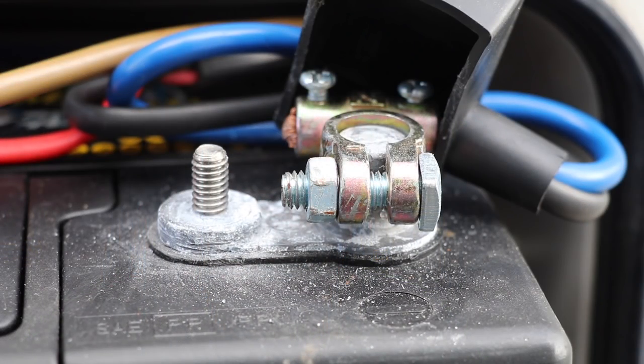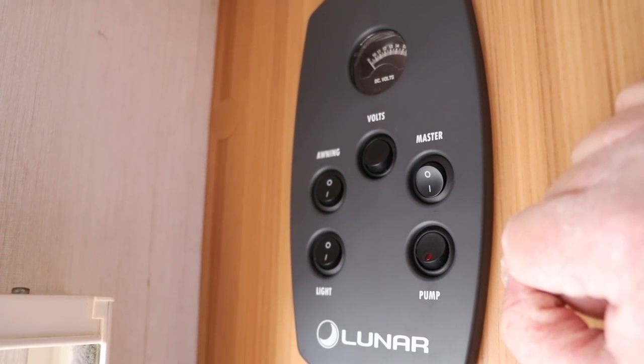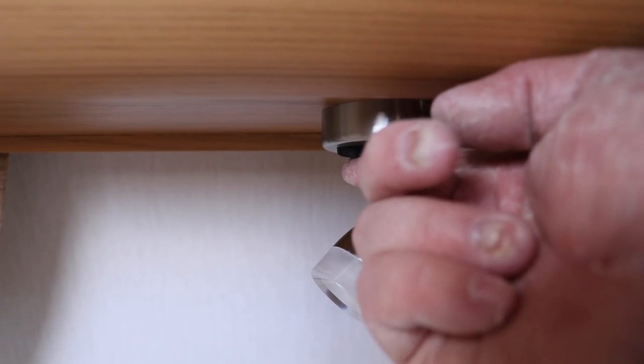Once we're happy with the battery, reconnect it back up to the caravan. Ours is permanently connected because of the solar panel, but it's a good idea to check the contacts — make sure they're not corroded and not fouled up. Give them a good look over and if need be clean them with some emery cloth to take the top layer of corrosion off the terminals. Once we're happy with the connection, nip inside and test the system by switching the caravan on and switching some lights on to make sure everything is okay.